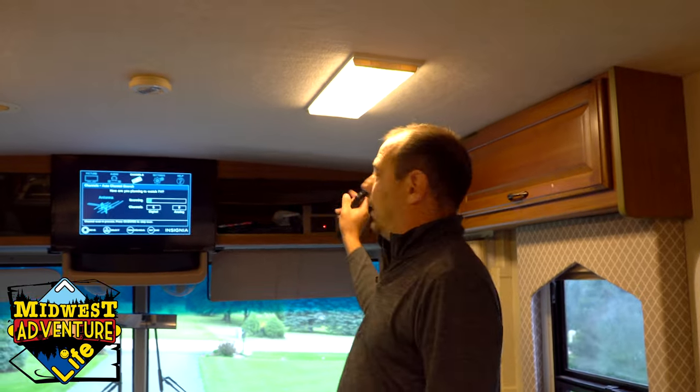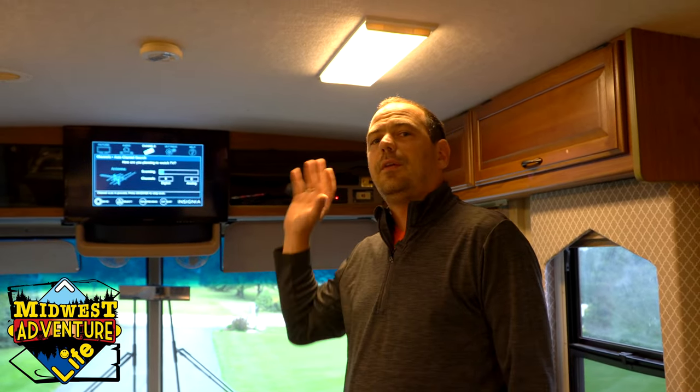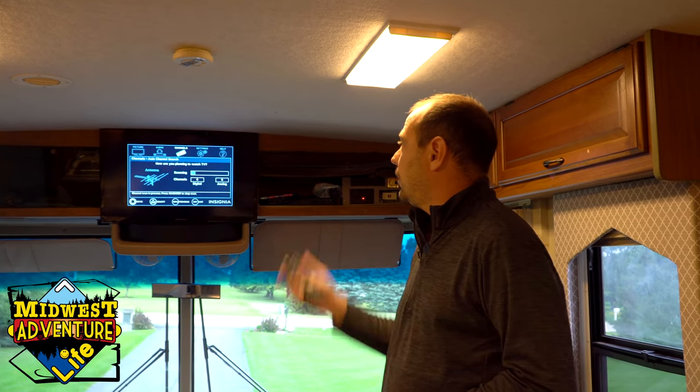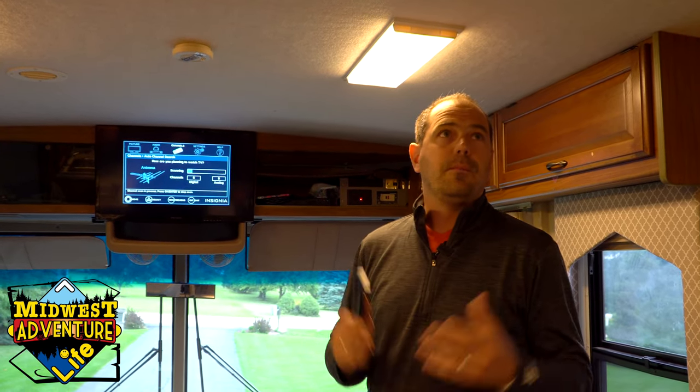These bi-directional antennas are pretty common on a lot of different manufacturer RVs, as is the antenna booster. The antenna booster is generally found in one of the cabinets near a TV. A common thing that's forgotten is to turn that on — people think they don't need a booster, but when it's off you don't get anything; when it's on is the only way these things really work. Go ahead and do a channel search. If you found this helpful, give us a thumbs up, subscribe to our channel, and we'll see you on the campgrounds.